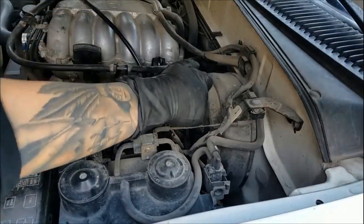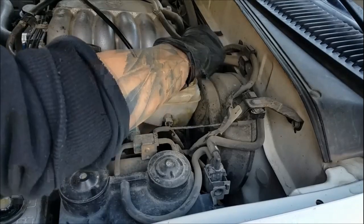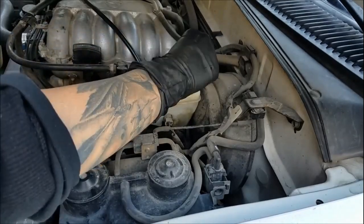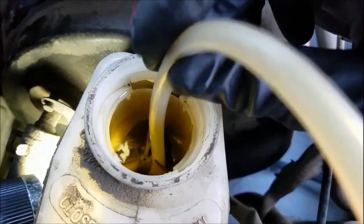On the truck I'm going to start by removing the reservoir cap and the screen so I'm able to get the hose of my Harbor Freight pneumatic brake bleeder right up in there and suck out all of that fluid, just so that I don't make a mess because brake fluid strips paint really easily.